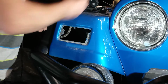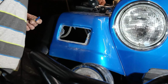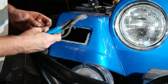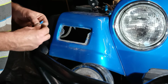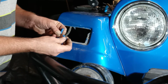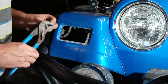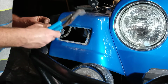I'm going to put this butt connector on there first. Don't have my wire crimps, but you can use channel locks, because all you're doing is smushing that metal down inside, so it holds the wire in there. Holds it good and tight. Alright. Put this next connector on. Crimp it down with my channel locks. It's good and tight.